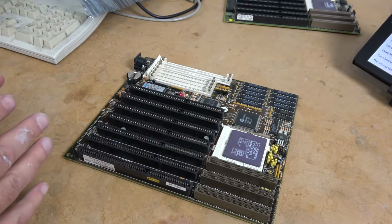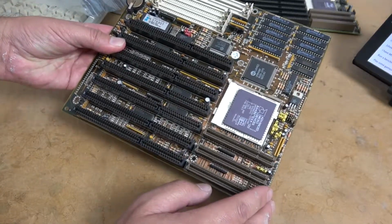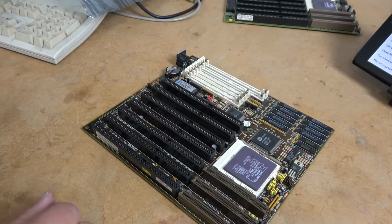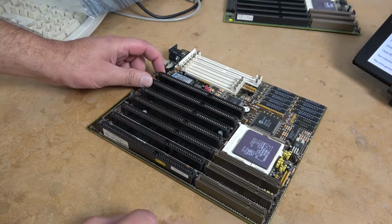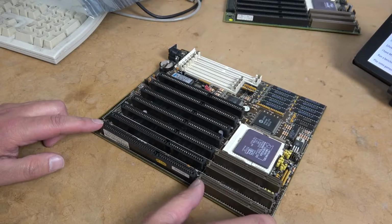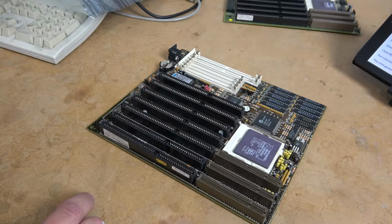And as the 486 was kind of a generational change, it's important to understand why things had changed the way that they were. For instance, the VL bus was added primarily so that you could get faster video performance. ISA video was notoriously slow. Intel added the VL bus extension, which really became the PCI of the 486 generation. It did have some limitations though.